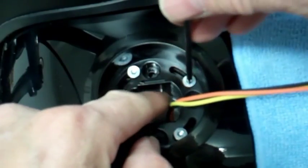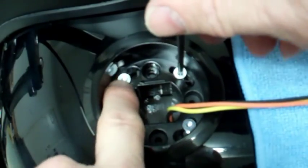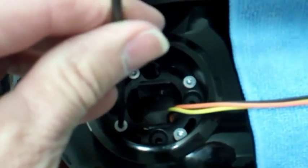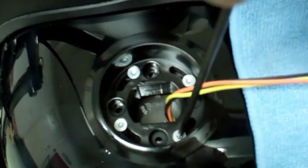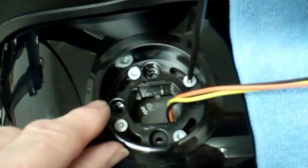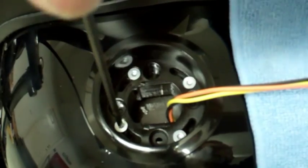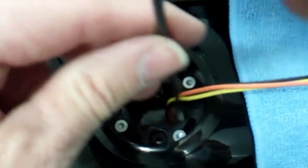And what happens is when you turn it, there's a recess. There's a recess right there, you see it? That the screw screws into. And while you're screwing it, the ring here is going flush, will be brought down flush to the tank. Sorry about that, I'm hiding it. Okay, you can feel now, see the ring is flush with the tank now. Tighten it enough to be tight, don't over tighten it because you're tightening the screws into plastic, so if you over tighten it, you'll strip the screw.